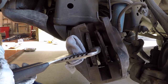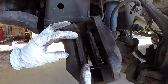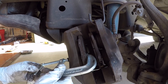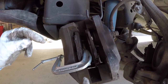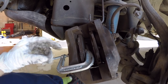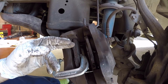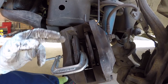I'm going to squeeze in and you can see it's moving, but the other side's moving on me at the same time. When I was compressing one side, the other side started going out on me. So what I'm going to do is hold one side with the C-clamp and then compress the other side. You might find that happens when you have a four-piston system. The fluid is looking for the path of least resistance and starts pushing the opposing pistons out. Once I have them held, the fluid will now take the path of least resistance going back to the master cylinder.